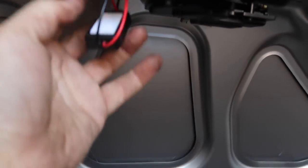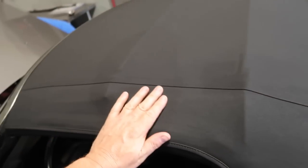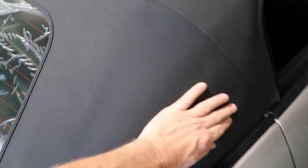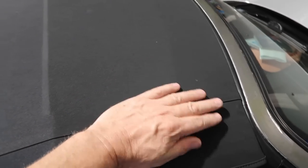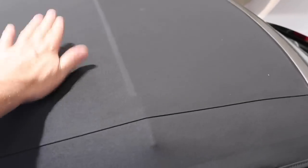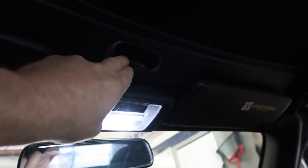Stick the double-sided tape inside the area so you can't see it. The top is on — look how beautiful that looks. They come in a box folded, so it's best to put the car in the sun once the top is installed to take the wrinkles out, or use a steamer. The fabric will be a little tight when you first drop the top — just help it close a little until it stretches. There's a handle that will help you close it and get your latches on.